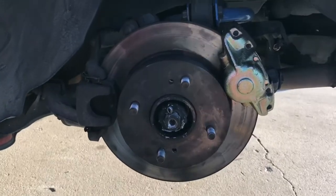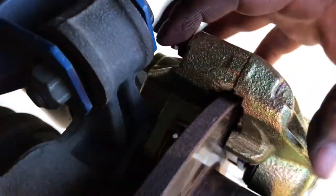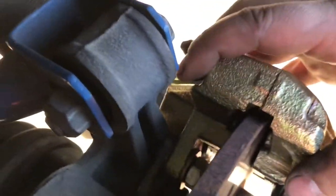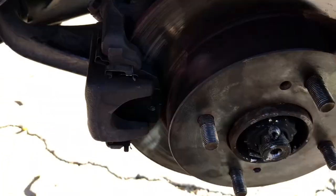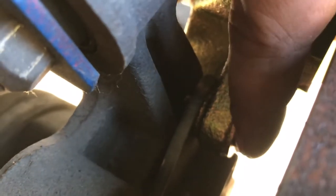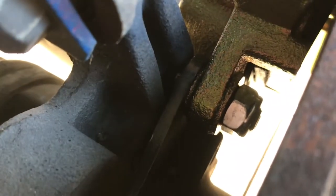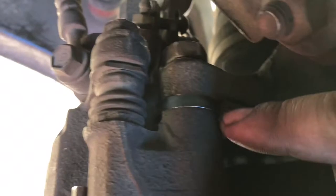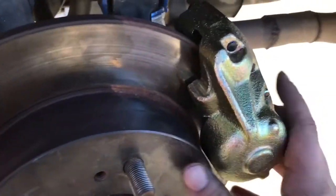All done with this setup — it wasn't too bad. Kind of a weird thing: when you put this on, you need to slide the rotor and the caliper on at the same time, because there's no way you can put on the caliper and then slide this in. They both have to slide in at the same time. You have to have the stock one off, slide this on — and it's a very little gap to thread these on for the front top and bottom, so it was kind of a little bit of a pain but it's doable. Then with an open wrench, tie them all the way down and you're good. Put on the spacer and the bolts fit perfect — everything threads, it's all legit, everything fits perfect.